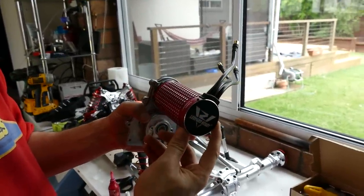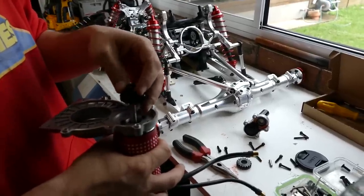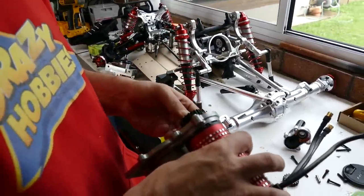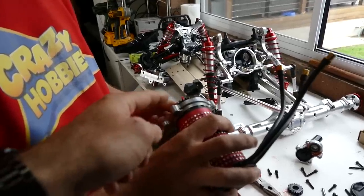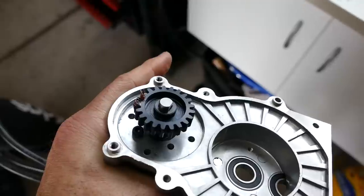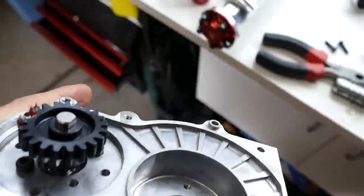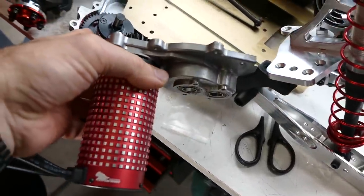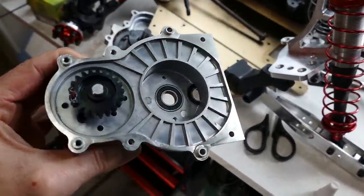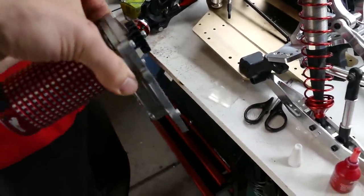All we need to do is put the pin on — there's no meshing because it's just pre-meshed. I'm fairly certain it's only going to go the other way. The pinion is actually keyed — so no more slipping on the shaft. You just need to figure out the distance to mate perfectly in line with the pinion and spur, put the casings together and see how they look. We'll make sure there's enough oil, put red Loctite on everything — this motor's not coming out again. Lock everything up and put this whole motor mount transfer case back together.